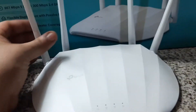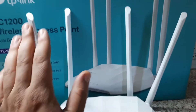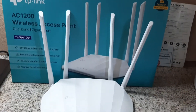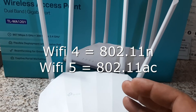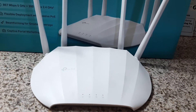Out of the box, this is what it looks like — you can see it looks almost exactly like it does on the box. One thing I do like about this one: we've got four tall antennas, so there's no doubt they'll be able to stretch a long way out. And also by having four separate antennas, if you're beamforming with one of them, the other can beamform with another one. If you have wireless n right now, which is Wi-Fi 4, and your access point says something like 300n on it, you're going to have a big upgrade here because we're going up to the next standard.